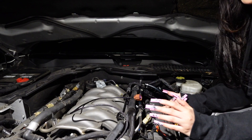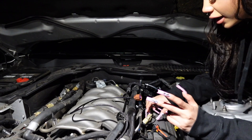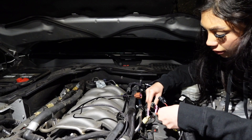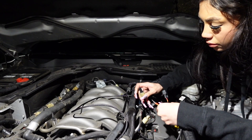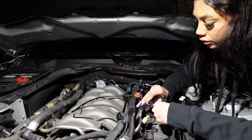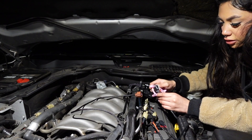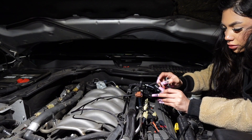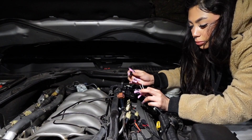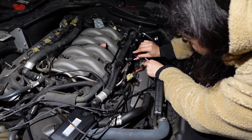For other cars you might need a multimeter, but thankfully for S550 owners we already have the connector labeled with positives and negatives. When I turn it over, I want the positive to be on the side closest to me, so just slide those in. I figured out it was way easier to connect the wiring — the positives and the negative — before fully connecting it. I've got these two done and will continue to do all four, then connect this inside.